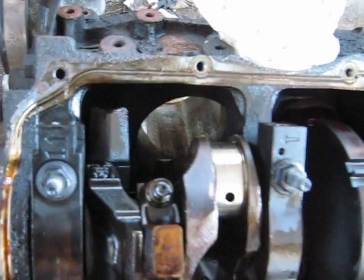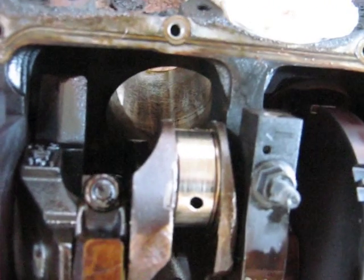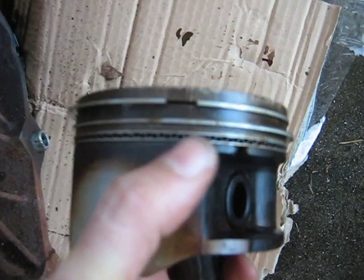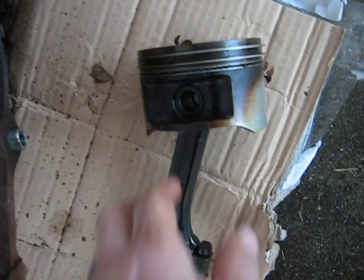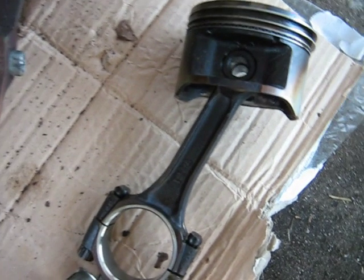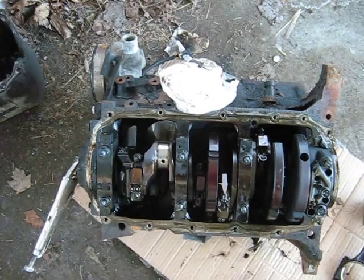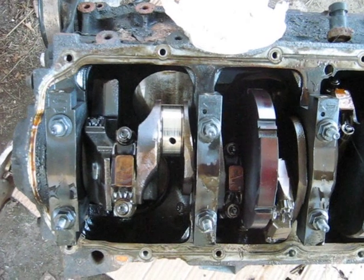You can see down the one cylinder there. You'd have a line of inlet ports somewhere around here, so I might be in for some grinding on the side of the block and drilling through the water jacket and the cylinder wall — it would be a fun project. You also have to pin the piston rings so that the gap on them doesn't end up hooking on one of the holes drilled through the cylinder wall. I had to do that on the sleeve valve engine. Just wanted to show you some of the fun things I've encountered with the baby Deltic V6 project.